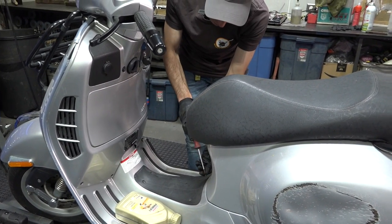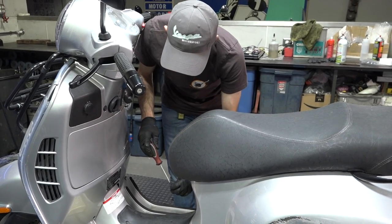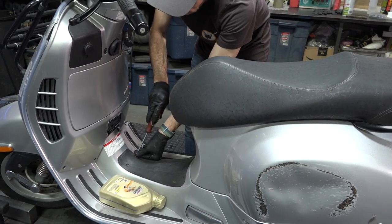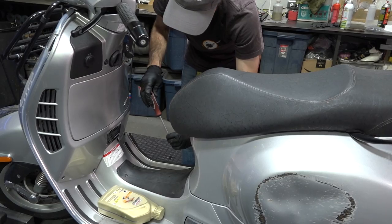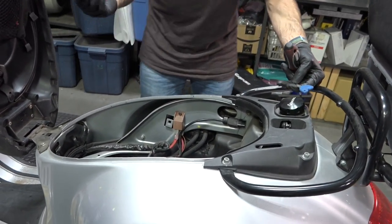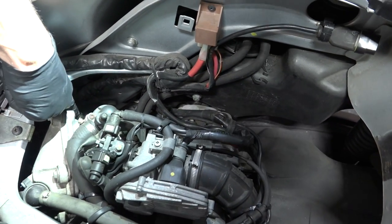If you're doing the cannonball, you have so much money invested — just buy a new battery, start with a fresh one, especially if it's more than a year or two old. Same with doing any kind of extreme touring with a Vespa or any scooter — always good to start with a fresh belt. Just like the belt, air filter, spark plug — probably start out with fresh ones before you do the journey. The spark plugs actually have a longer life typically than the dry belts. There's a clamp holding the spark plug lead on, so I'm set up for success.